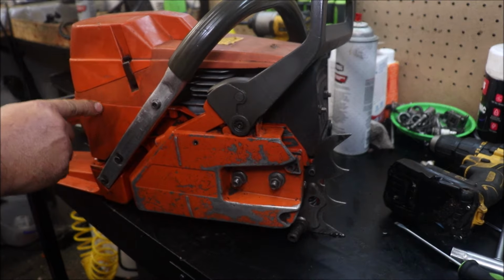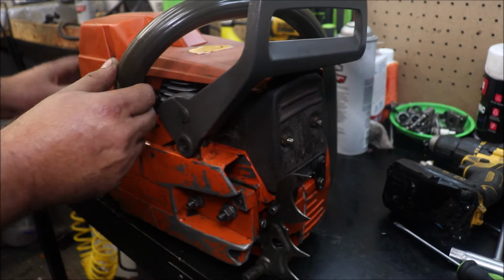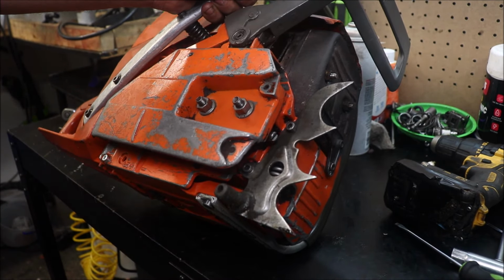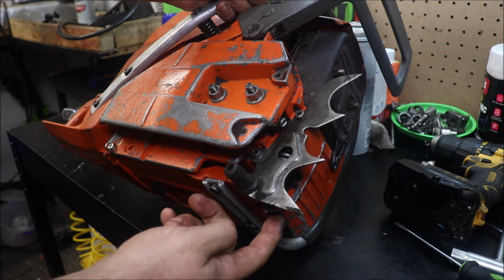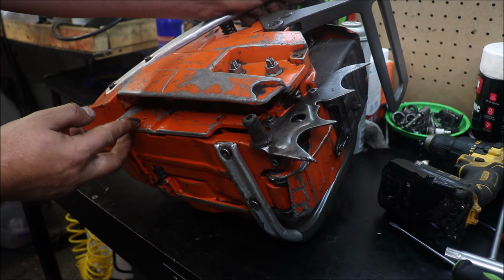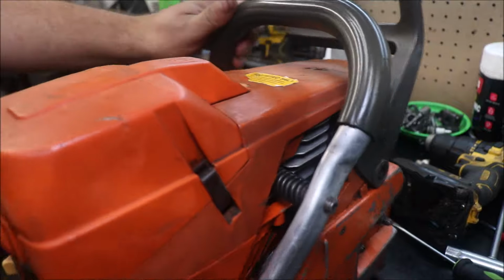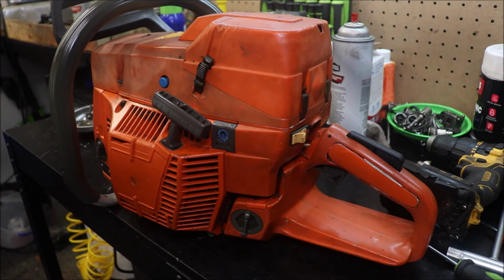This one looked good. I ran it through the ultrasonic cleaner and put it back in. The one on the front was good. The rubber ones, this one over here was good. It just needed a washer and needed tightened up. The holes on the front of the thing are all wallowed out in the cases. This one over here I replaced, and I'm talking little rubber bushings on the bottom. Hopefully you can see where I'm pointing. As well as, it had no type of rubber inserts down here at all. So I dug around, I had some of those and put them on it. So it feels good now, good and tight, about like it would have if it was new.